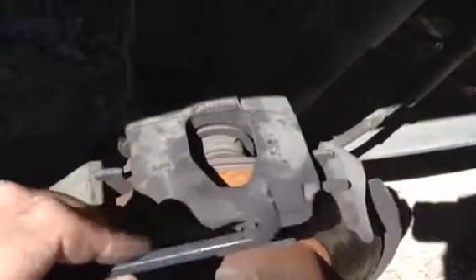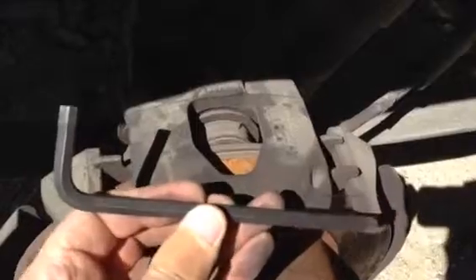This is a 7mm Allen wrench with a nice long handle. I brought it along because that's what I need for the nuts back here. I've already loosened them up — these nuts come right off and I'm going to do this to both sides, right and left rear of this vehicle. We're going to unscrew these and pull the entire brake caliper right off.